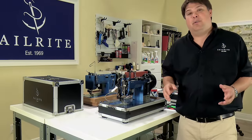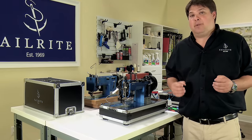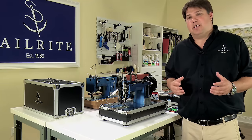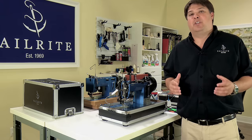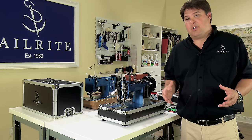In this segment I want to talk about driver rotation. Driver rotation is one of the elements of timing your sewing machine, and this particular process is very important to understand because if the driver is not set properly, the machine just won't sew. You're going to end up with skip stitches or no stitches at all.